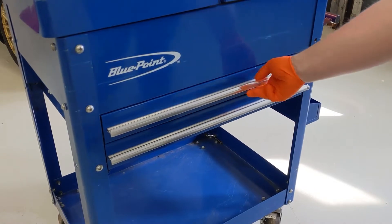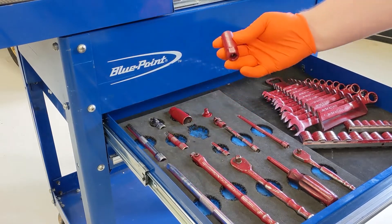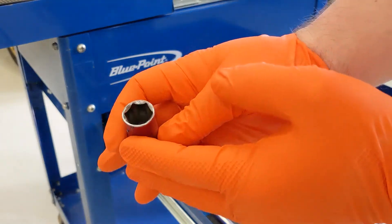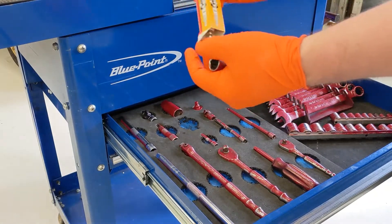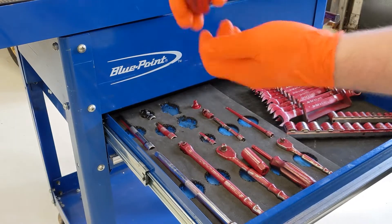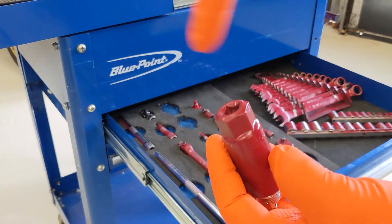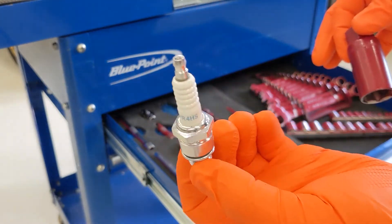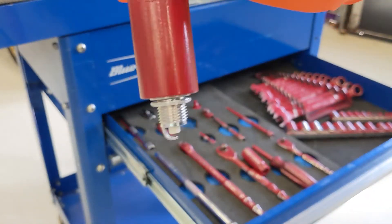To remove the plugs we're going to need to use some special tools. In our tool boxes there are two special sockets up top in their own foam cutout. They look like regular deep well sockets except there's a hex back here so you can use a wrench if you need to. If you look down inside the socket there's a little rubber grommet in there, so when you go to actually remove the spark plug — just a regular copper NGK plug — the rubber grommet will hold it in place. The plugs on the Del Sol are actually a couple of inches down in the cylinder head. If you were to just unscrew them with a regular socket, the plug would stay in the hole and the socket would come out, and you'd have to get a magnet or a long pair of pliers. These special spark plug sockets grab onto the top so that when you remove the tool, the plug comes with it.